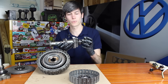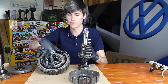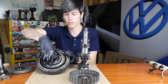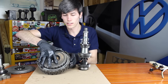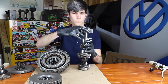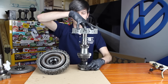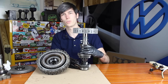This is the input shaft for the transmission, and it's actually two shafts — one is around the other. You've got these two clutches here. This piece, which splines to one of the shafts, rotates the inner clutch, as you can see there. And then this outer piece of housing here rotates the outer clutch. When you stick this on here, you can see it only rotates with the upper shaft. And then as I put that on top, that rotates with the other shaft. That's how you're controlling the odd gears and the even gears with these two shafts.